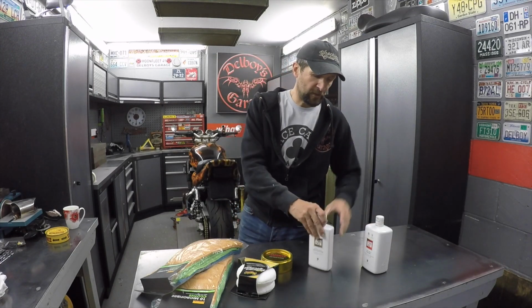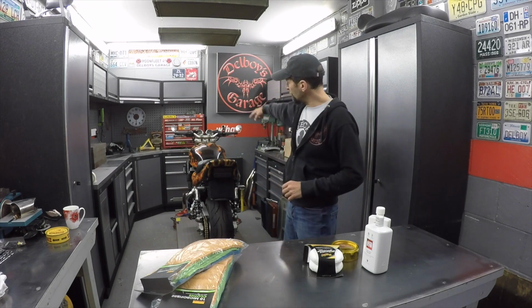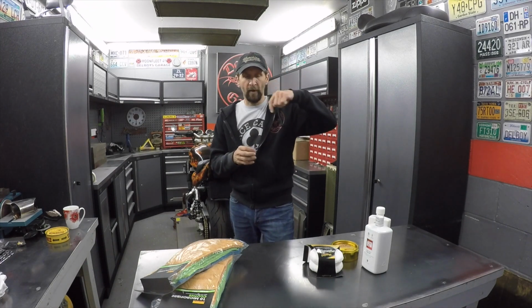Now, in my personal opinion, what I like to do with fresh paintwork that's never been polished, I like to finish off the buffing process. Because what we did with the G10 compound was we got it right up to this lovely glassy finish. It looks like a glassy finish, but it isn't. When you look really, really close in sunlight, you can see all the little swirl marks in it because the G10 is a rough compound. Even though it's very, very fine, it's still a cutting compound nonetheless, and you'll never change that.